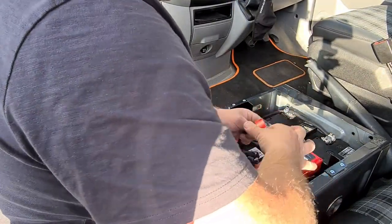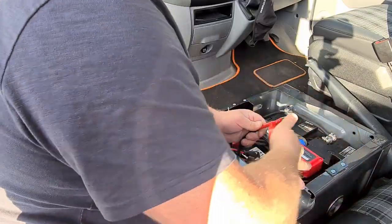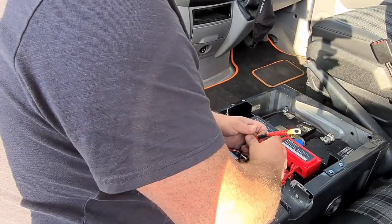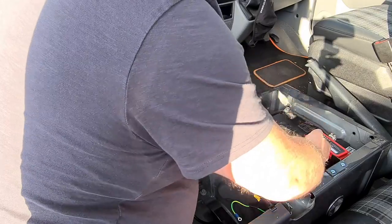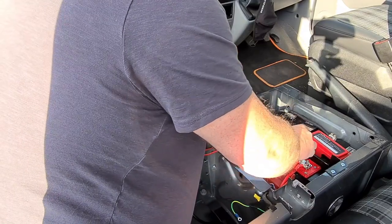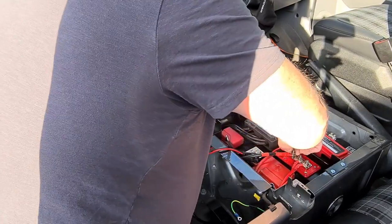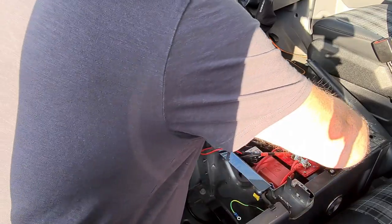Once again, we need to distinguish this cable from the other black cables. This is a 12V supply and needs to be shown as such. Using red tape to mark this cable and distinguish it from all the others is more than adequate. Then it's just a matter of terminating it, putting it to bed — connecting it to the bus bar. Always use insulated tools when working on your batteries. If you can't find insulated tools or don't have the money, use insulation tape — just cover up the ends. Anything that can come into contact with an earthed part of your vehicle, just put some insulation tape on it. It's a cheap alternative.